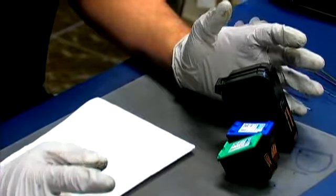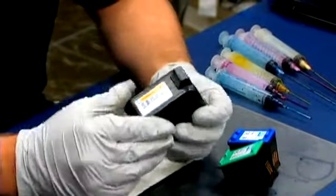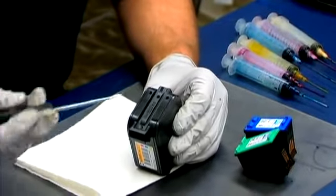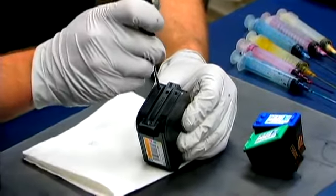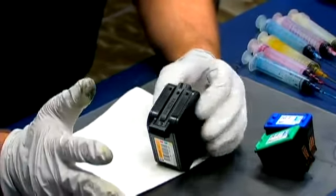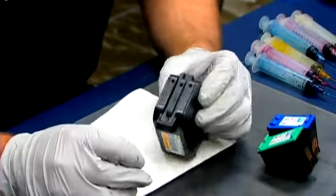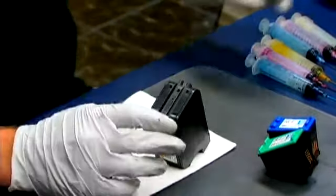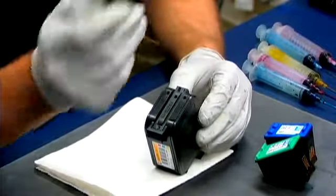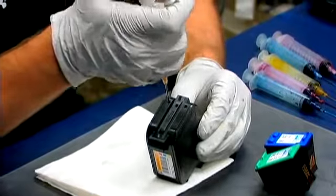Three of HP's most popular tri-color ink cartridges are these. This one being the oldest, we'll do first. At the top there will be three plugs. Simply push the plugs into the center of the cartridge. Don't worry, there's a sponge that will keep it from going anywhere or causing damage. Once you push those in, get a syringe with a long needle, fill with ink about 12 milliliters, insert and depress until full.